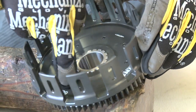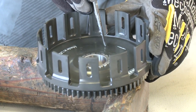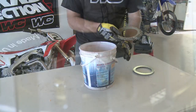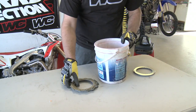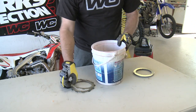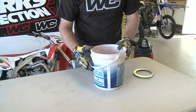At this point we flip it over and wipe off any excess Loctite. We have a punch and we're going to peen right where the bolt comes out, where the aluminum and steel meet. That's going to help keep the bolt in place if it ever were to come loose. Then it's a good idea to have a little bucket with fresh oil, and drop the plates in individually one at a time so oil gets in between each plate. Let them soak for at least 20 to 30 minutes — longer is even better — while you're putting the clutch basket back together into the bike.